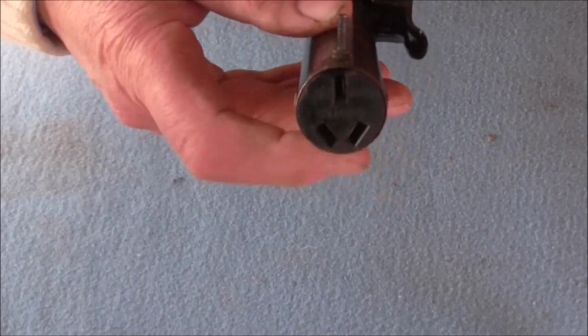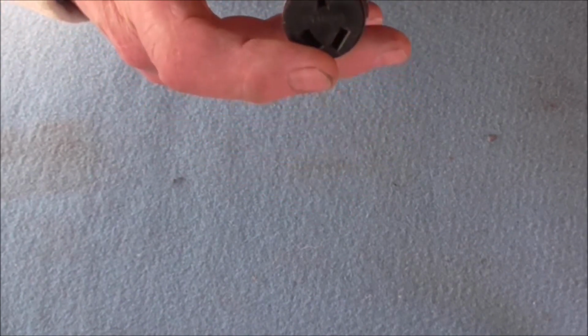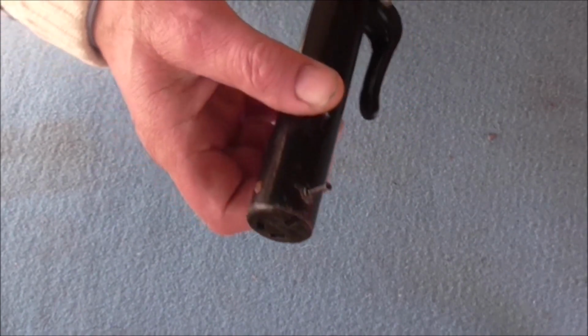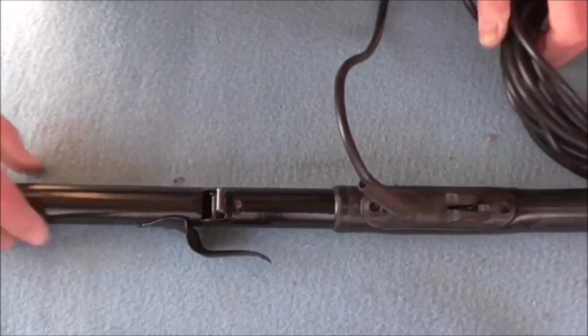And on the bottom I fitted the socket for the connections to the machine itself, a 3-pin, which denotes it's a 2-speed model. There's just an earthing band to go around there, and perhaps a bit of paint scraped off to make sure it earths. And then it's a simple matter of fitting it on the machine.